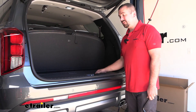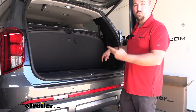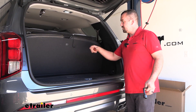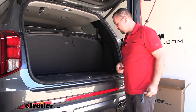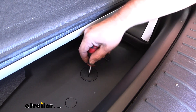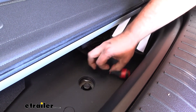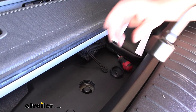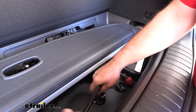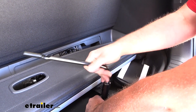The first step to installation is lowering down our spare tire, which will give us enough space to get our hitch in and also work underneath. If you've never lowered your spare tire on your Palisade, it's pretty easy — just open up your hatch and rear cargo area to access the plastic cover. You'll see the spare tire here; just loosen this up, and using the tools from your vehicle's tool kit you can use the lug nut socket, with the extension if needed, to get it loosened up.